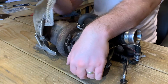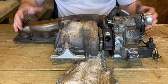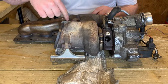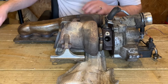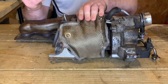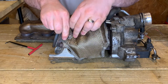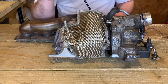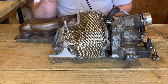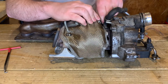Just going to lift the turbo up to achieve that position. Once we're sitting here, we're going to reach down and grab the two springs — one here and one down there — and I'm going to use a spring puller tool and just fold the turbo blanket around. This isn't necessarily going to sit perfect until both springs are in place. Once you've got hold of that spring, secure it there. Then locate the second spring on the other side of the turbine housing and run it underneath the actuator arm onto the second anchor point.